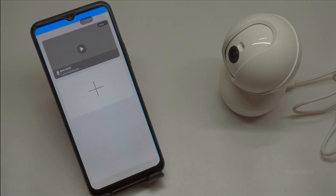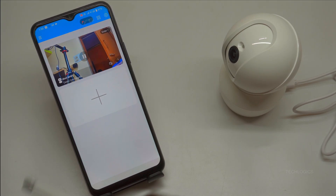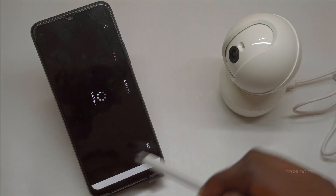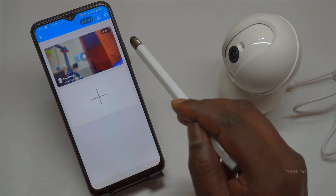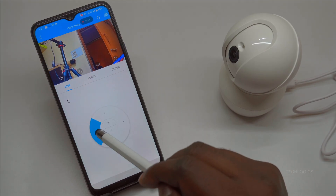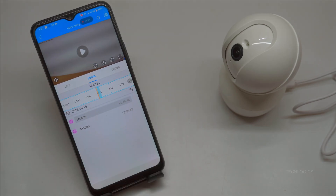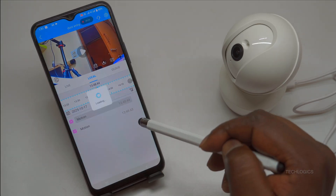With Wi-Fi and storage configured, you can now mount the camera on a shelf, wall, or ceiling using the included hardware — secure it firmly for optimal coverage of kids, pets, or entryways. After mounting, the camera offers full functionality: seamless live streaming, event playback from the SD card timeline, and smart PTZ tracking. Access everything remotely via mobile data or Wi-Fi from anywhere in the world — just open the app and tap your device. Test the two-way audio by speaking into your phone mic; you'll hear it through the camera speaker, perfect for chatting with family or sounding the siren alert. To finalize, tap the Settings gear icon, scroll to Device Info to set the correct date and time zone, ensuring accurate timestamps on recordings. Then visit Recording Settings to customize preferences like motion detection sensitivity or storage overwrite. For deeper guides on alerts, two-way audio, person/human detection, and more, check our dedicated videos in this TechLogix series.